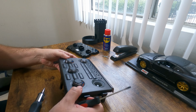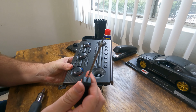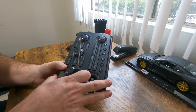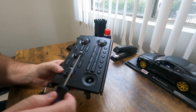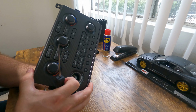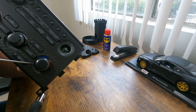Now the next part's the nerve-wracking part. You gotta get these dials off of the knobs. I got a nice skinny flathead screwdriver. You don't need the needle-nose pliers. Apparently in the CBAs, you can just remove the entire faceplate, but I guess these knobs are a little bit wider, so you have to remove them before. So fortunately, it is kind of loosened, as you can see, which means you can get a screwdriver in there. Small one, and just kind of work your way in there